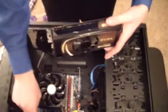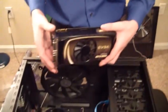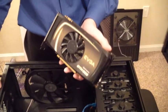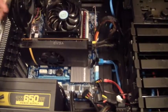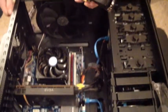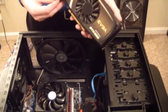Here is the other graphics card. Why is this graphics card going on top of this one? The reason is you want the more powerful of the graphics cards on top. When you're installing two cards, you want to make sure you're using very similar cards. In this case, this is a GTX 560 card, and so is this one. It is a GTX 560.